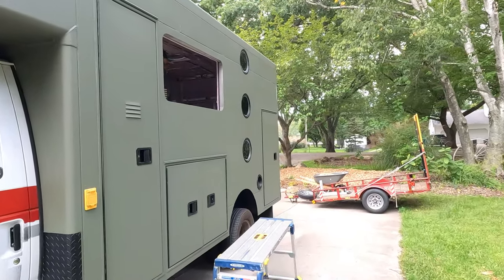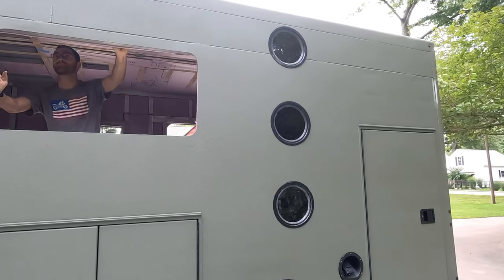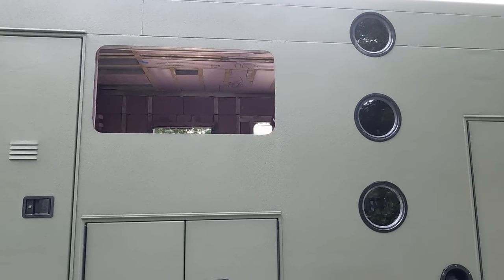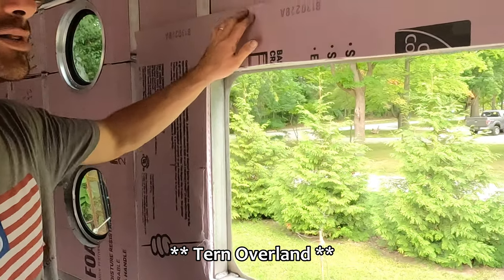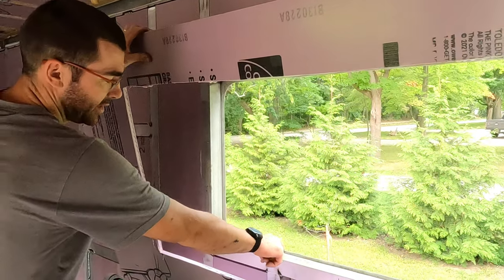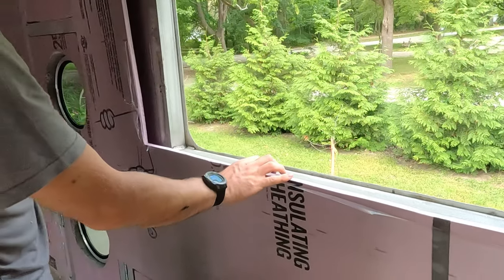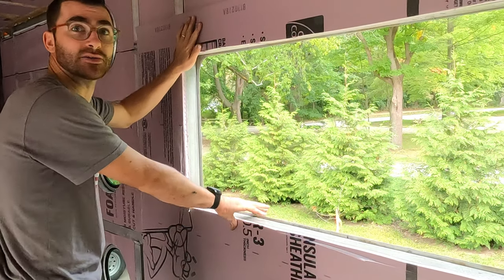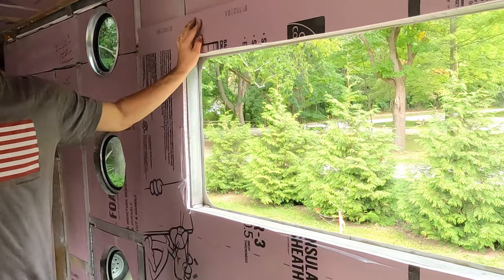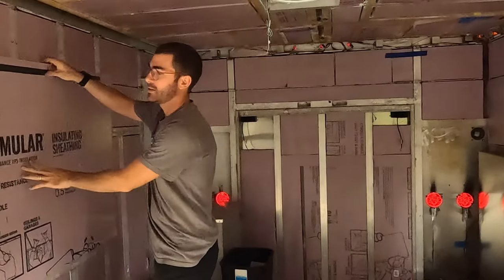Today we're getting the outside buttoned up a bit. We have these porthole windows in, and Case is on the inside getting the window ready for install on this side. We bought an Arctic Overland window, and it was designed to fit a wall gap of 2 to 2 and 9-tenths inches. Our wall was too skinny, so we're adding insulation so we can fully tighten the window and make it nice and watertight. We just cut out a window opening and we're tracing a gap so we get a half-inch clearance all around.